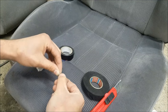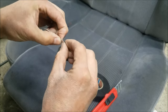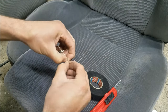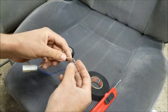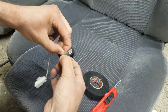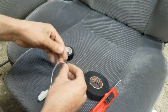I'm not going to solder the resistor to these wires mainly because there is no current coming through them, so I'll roughly connect them and make sure everything is nice and tight. The main reason why I said you shouldn't do this on your own is because I'm trying to replicate the resistance when a grown adult is sitting on the seat. If you put the wrong resistance value through these two wires, you might eliminate the light but in the event of a collision the airbag might not deploy. If you put too high a resistance, the airbag is not going to activate — it will just think the pressure plate is active but that no one is sitting on the seat.